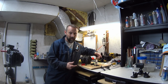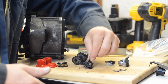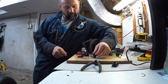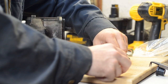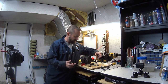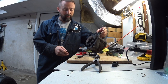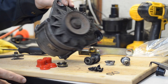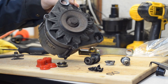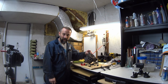My bushings were actually mush — they're done. It's a pretty easy job. I'll get more details on the parts as we put it back together, but for now I just need to clean up my alternator the best I can without getting dirt and debris in it. I might wire brush it a bit, clean out the bushing areas, then start popping the new bushings in and get it all back together on the car.